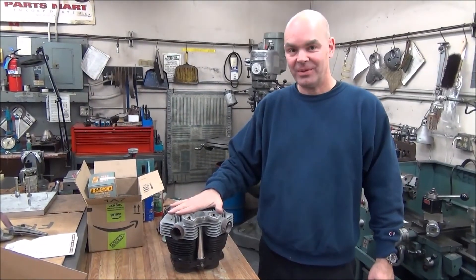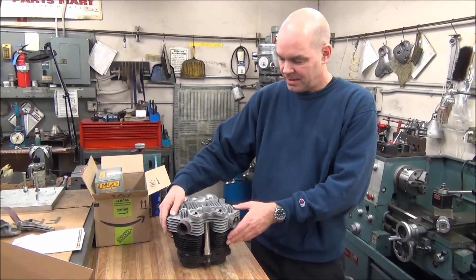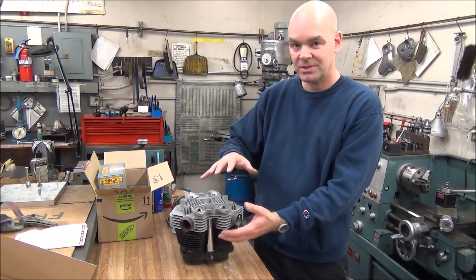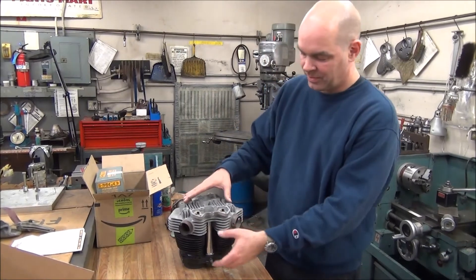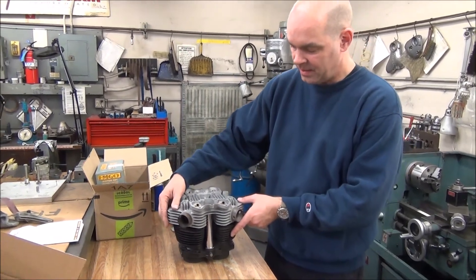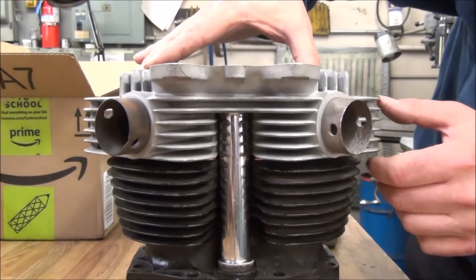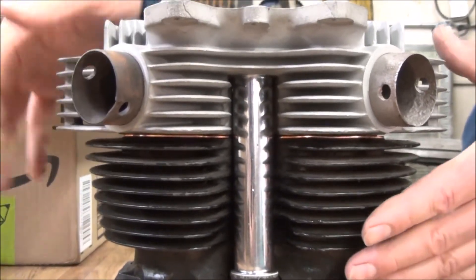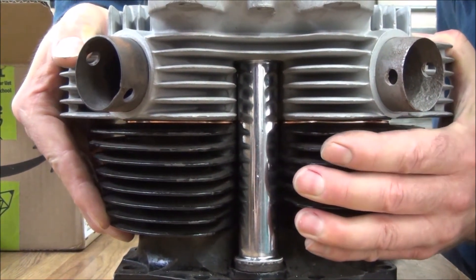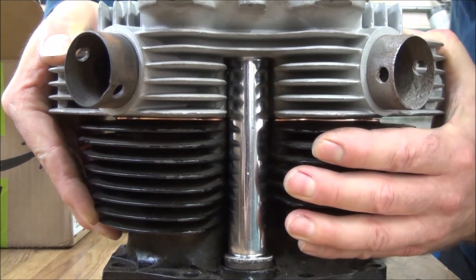So what we want to end up with is a reasonable amount of compression onto the pushrod tube seals, such that it compresses the seals but not so much that it squeezes them out, and obviously not so little compression that the pushrod tubes aren't compressed enough to seal. We're going to get another shot of what we think is a good amount of compression, where with the stack height you can see the head is more or less floating free, and with hand pressure — not bolting it down — we can bring the head down to meet the gasket. To me, that's a good amount of compression on the pushrod tube seals. This would be a good installation here.